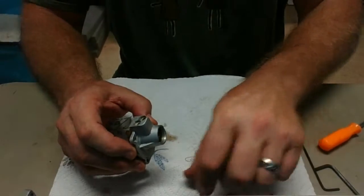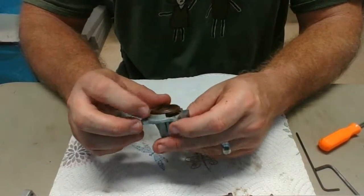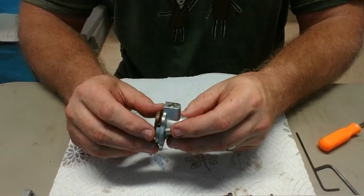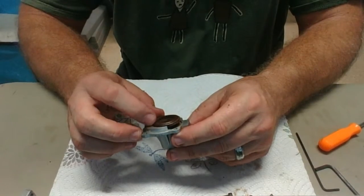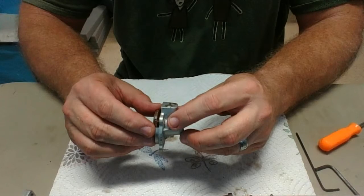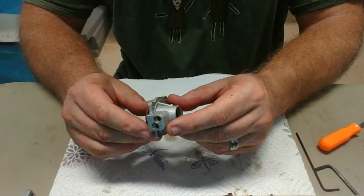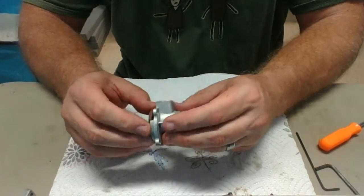As you may recall, I had parts soaking in acetone, and the acetone really dries things out. When this is done, any of the steel parts I'm going to soak in basically the generic brand of CLR — calcium lime rust remover — it'll clean these parts up really nice. It's okay to use on steel parts, but I don't really want to use it on aluminum because it tends to discolor it. It'll eat any finish off the aluminum, though I'm not sure there's any finish on these.